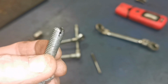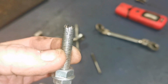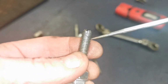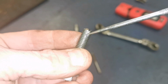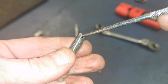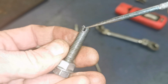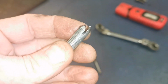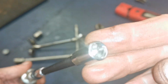So what we'll have here is an M8 by 1.25 thread pitch, which is what that hole is. And I had it deliberately that length so I can eyeball it to see if it's straight. So I'll show you how I kept it straight. And we'll have a chamfer at the top and we'll have a slit in it. As you can see, there's still a bit of debris from some of the aluminium threads that are now gone. So the guy's destroyed the first couple of threads in this, but whenever we get past that and then on up in, it's fine. So your debris then gets caught in the slot there, and that allows you to screw it in. The chamfer at the top is made by this wee tool, one of them wee guys there. You can put it on the end of a drill, or I have it rigged here. It just goes onto a quarter driver.